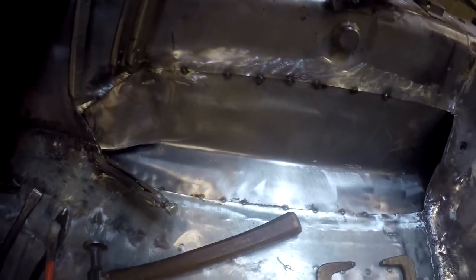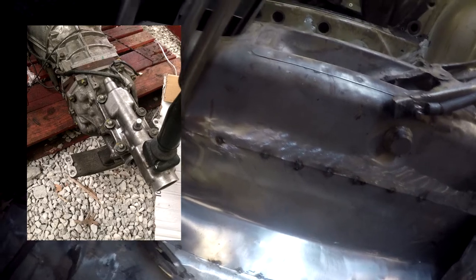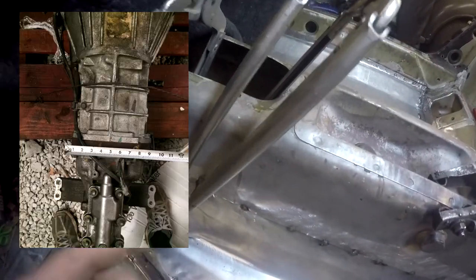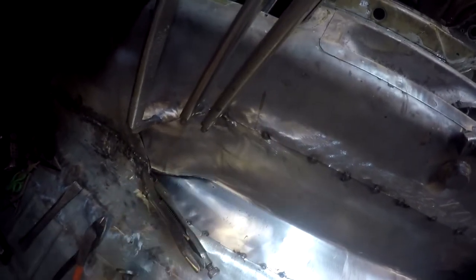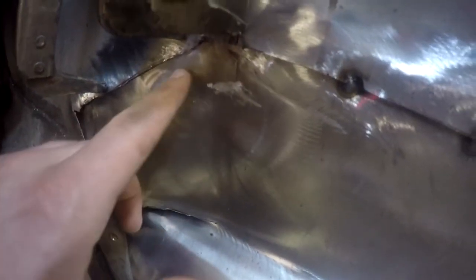Rather than lugging that big transmission over here, I was smarter and just took some measurements. I'll add some pictures of the measurements — basically where the shifter is going to come through and where the transmission mount is going to be. The transmission is really narrow so I don't have to worry about any fitment issues. I've got it all clamped in now. I still need to do the same to the back, but I might just wall it off with a piece of metal there because if I cut and notch it and bend it over, I'll actually lose a little bit of bracket space for my seat. So I'll wall it off to get that extra room rather than it coming in at a curve. I've got this all clamped up with good fitment, so I'm just going to go ahead and lay some tacks.